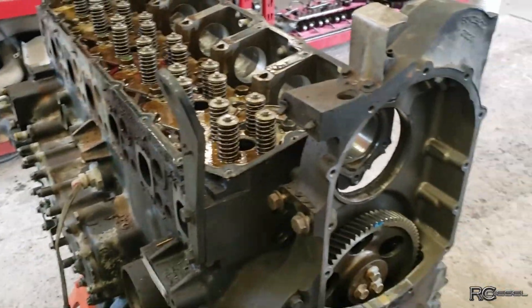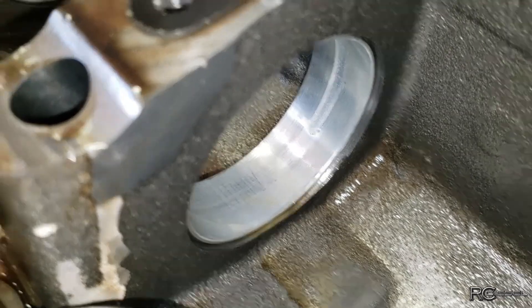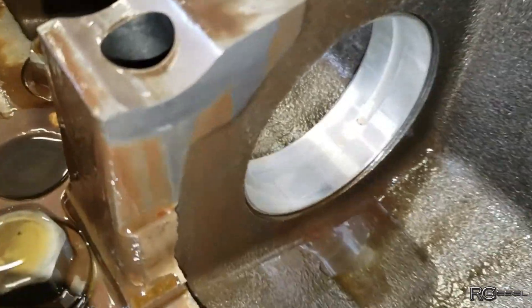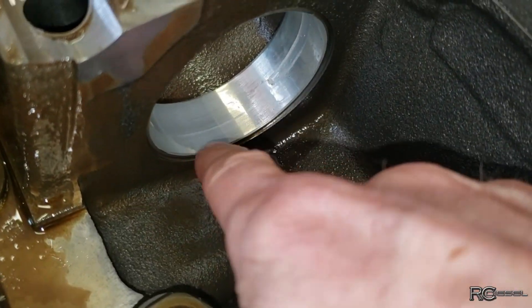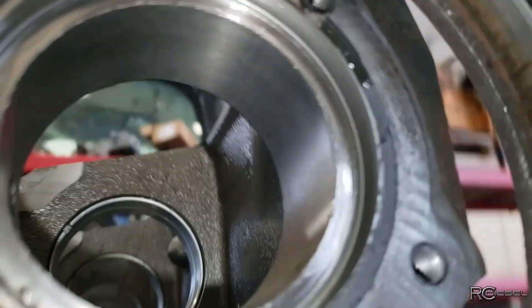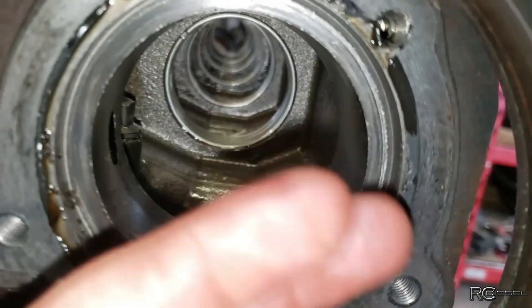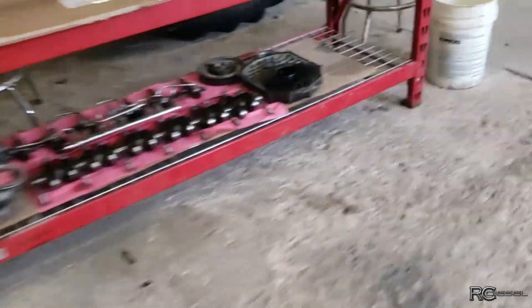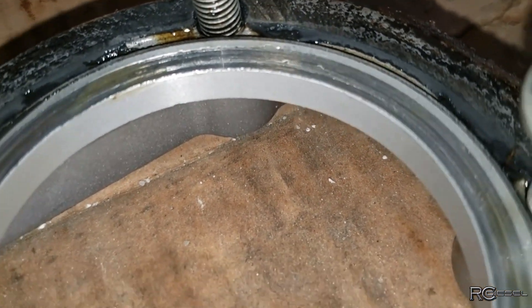Camshaft is out — I thought I was recording that but I guess I wasn't. The rest of the bearings actually don't look too bad. You can see a little bit of chattering down there on the bottom, a little bit of wear spot — that's pretty normal stuff, nothing too serious. This one looks like it may have had a little bit of debris go through it — you can see a scratch there. That one may be too. And of course the first one is real bad. It doesn't look like it actually really spun that much inside there, but there is a burr right here. This is where the flange of the cam rides, and that spacer plate holds it from walking back and forth. And that spacer plate — oh, this is pretty chewed up. You can see how much that's chewed up and worn in there.